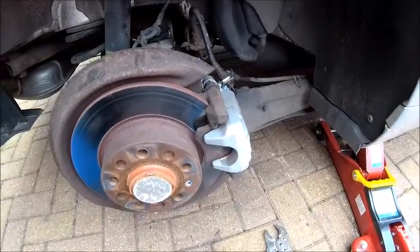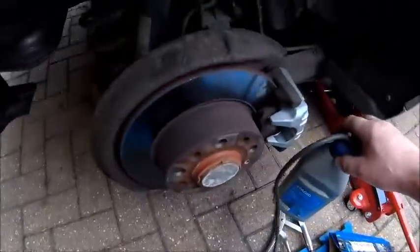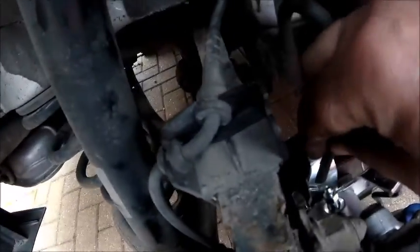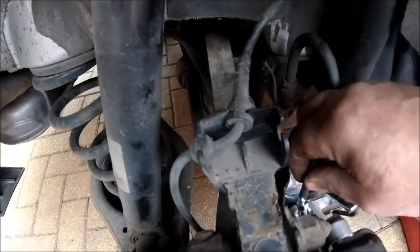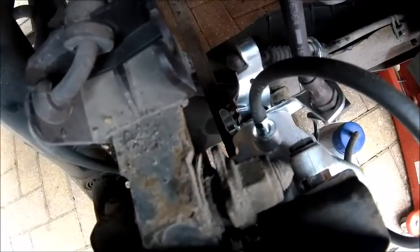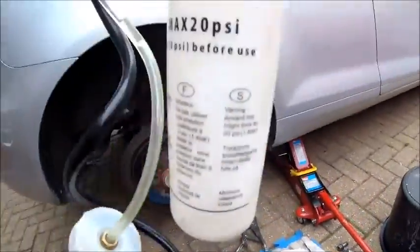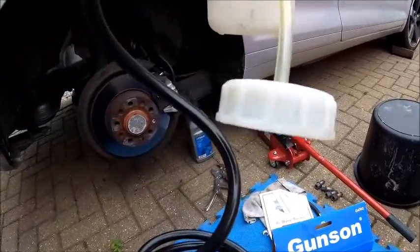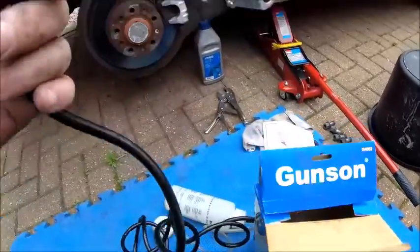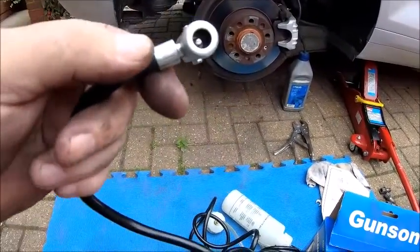Let's get the easy bleed out and get it done. So this is how I bleed my brakes. I've got a bottle here with some waste fluid in it — that goes on there, a nice tight fit so you don't get any spillage. That's on there for any stuff that comes out, and the pipe's right down at the bottom so no air can be dragged back up again. This is my easy bleed — only about 20 quid but well worth the spend. Basically you've got a bottle that holds fluid, that cap goes onto your reservoir, and then you connect this up to a maximum of 20 psi. I've got an old wheel with 20 psi in it that I use for this.